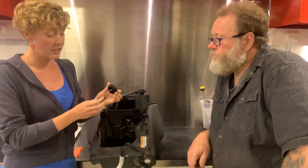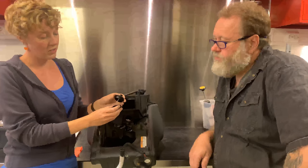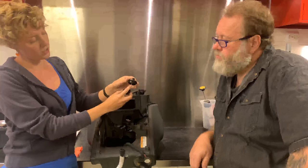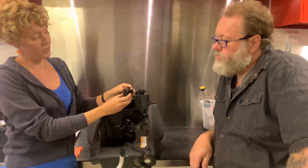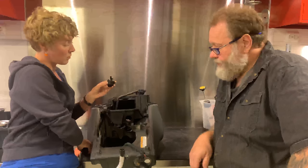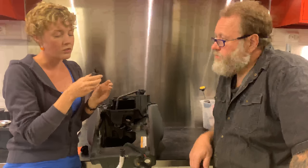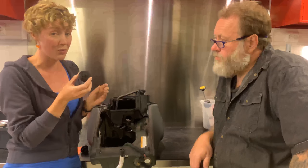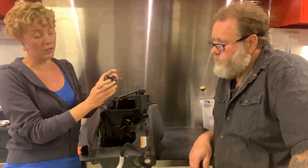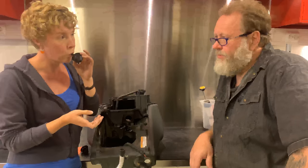What it does is this ball sits in its little bowl here. When the bike is running, this is of course shaking and going back and forth, and then it is touching this part of the valve. Just because I like making a fool out of myself, this is the unopened one. When the ball inside is touching the white part of the valve, like so, you can blow through, right? So now it's open. But when it is a little bit to the side, like this, like when the bike is parked. Exactly, on the side stand. Theoretically.